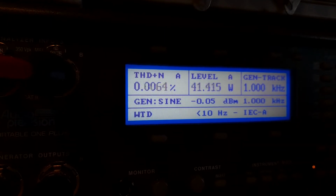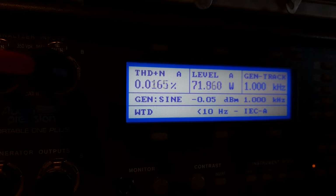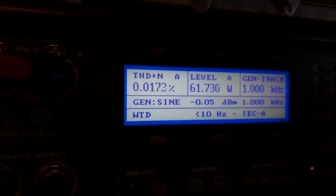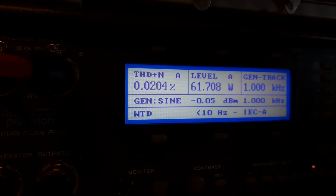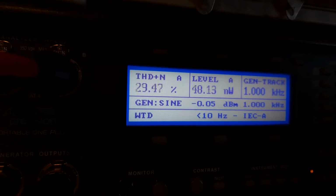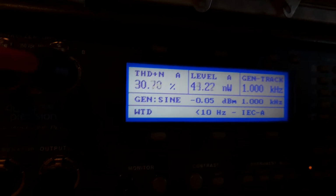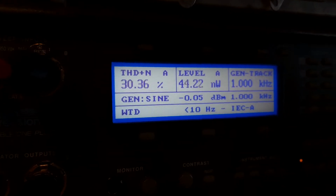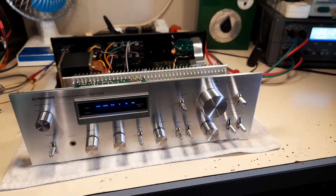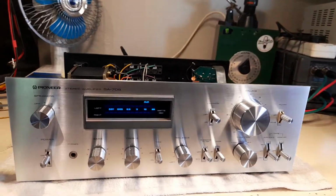Let's get it to approach. It's rated 65. Oh gosh, 65 watts rating or 60 watts rating. Look at that distortion figure. This thing benches at over 80 watts, and it's rated as a 65 watt per channel amplifier in, from the official publication by Pioneer back in 1980, which is spectacular.